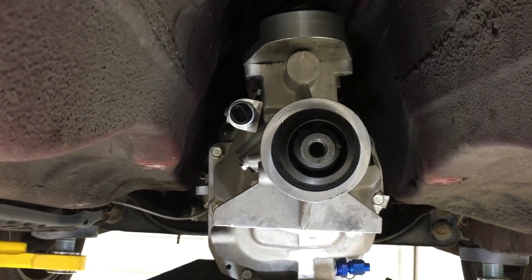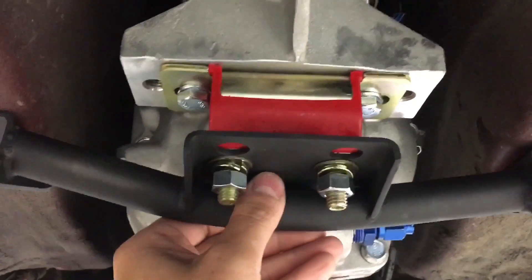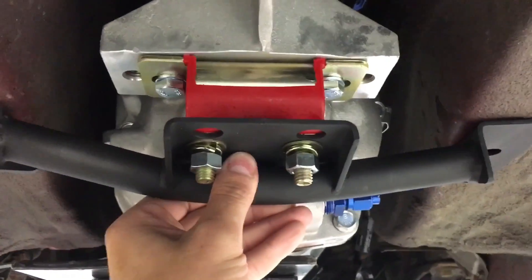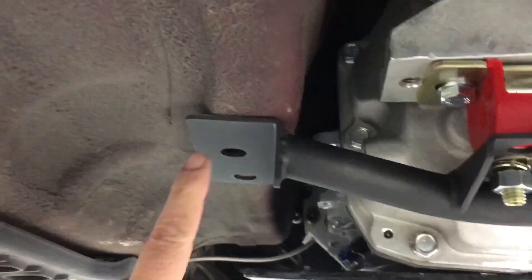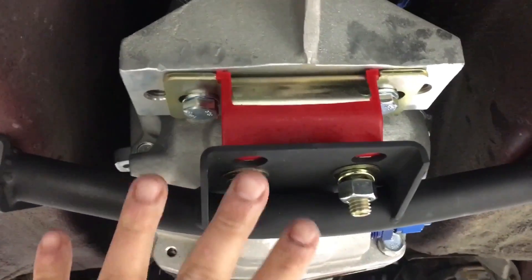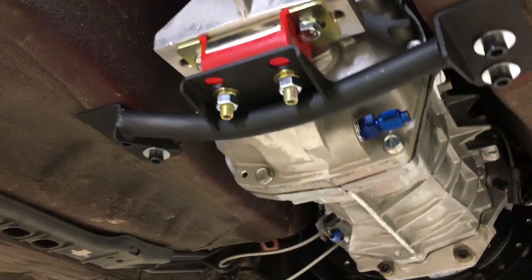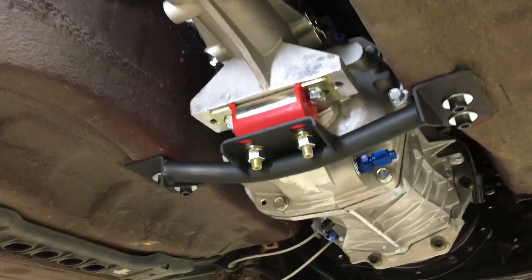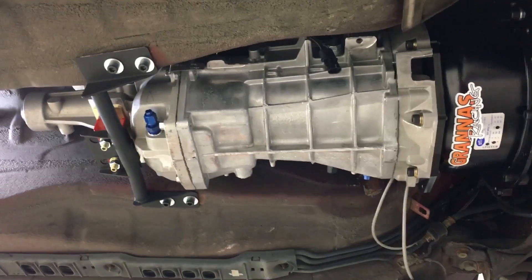The transmission is lifted up and the cross member is installed temporarily. What I like to do is leave everything loose until I get everything lined up properly — these bolts stay hand tight, then install all four of your cross member to chassis bolts, and everything gets tightened up once you have all your bolts in and lined up. So there you have it — a completed GR700 swap, though this is actually a GR1000 trans. Everything is in and tightened down, and we have a working assembly other than bleeding the clutch, installing the driveshaft, and doing some electronic work. In the next episode I'll be back to wrap this project up.